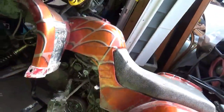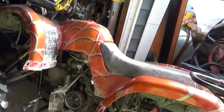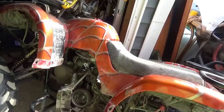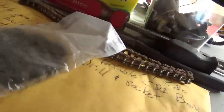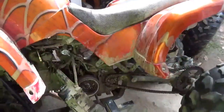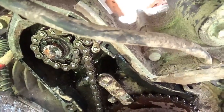I'm going to have to get that CDI off of there — the advanced sparking CDI. I broke one timing chain, I broke a second timing chain. Luckily I did buy a spare. But that CDI puts the ignition curve too far out front, and when it kicks back it just breaks these chains — so we can't have that.